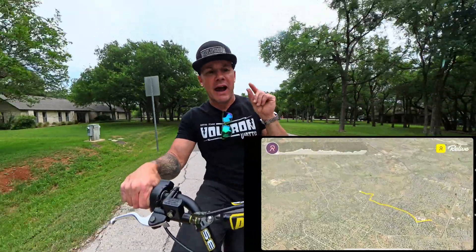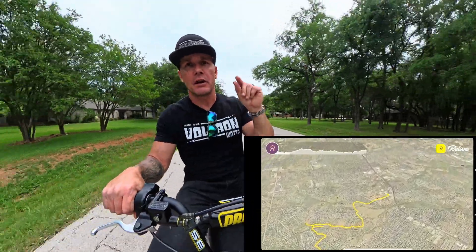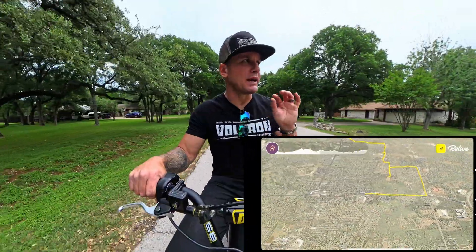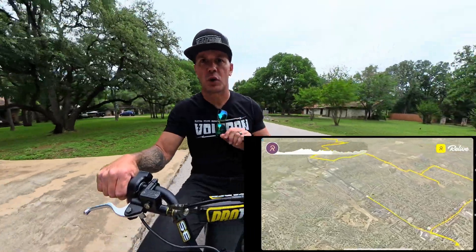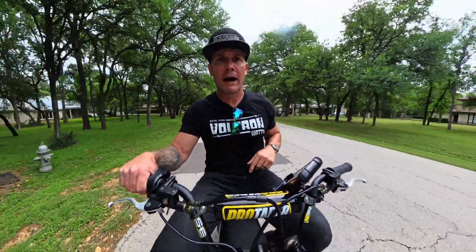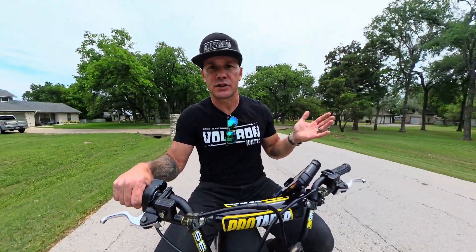I continued on with the range test. I got 20 miles of range on this bike. I'm sitting at 67.4 volts and my low voltage cutoff is 65 volts, so I'm getting really close to the cutoff in the controller. I was carrying about a 30 mph average speed on the street — doing some long stretch drags and then coasting, trying to mimic what I think the viewer is going to do. So 20 miles of range from a 72V 20 amp hour battery. Keep in mind I have dirt bike tires — if you have street tires or super motos you can probably expect a little more range.